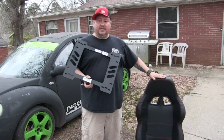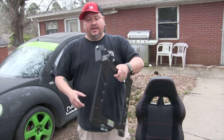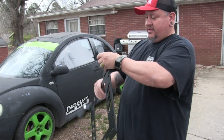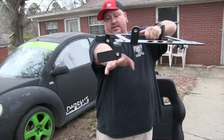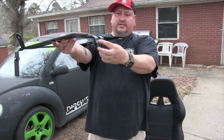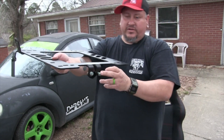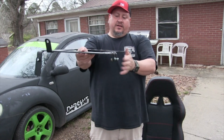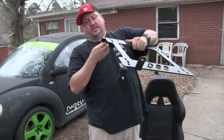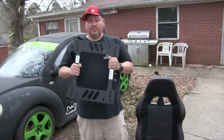This is to put a racing seat in my sister's Jetta — she picked up an MK4 Jetta to race with me. The sweet thing about this is it's got two pieces of metal that slide into the factory sliders in the back. You slide those in, then mount the front two holes with bolts. Note: the bolts don't come with it, so you'll need to get some. Once it's in, you tighten the bolts down right here and it locks the thing in place.